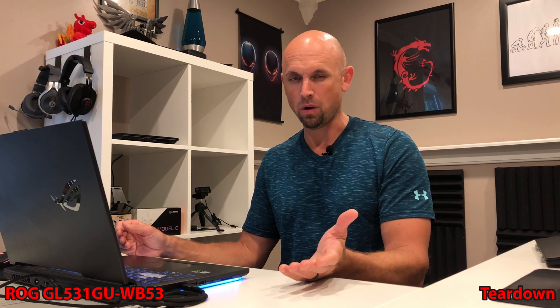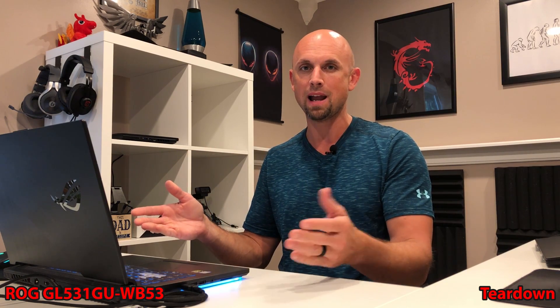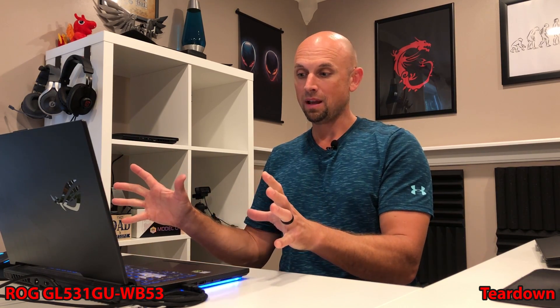To honor that individual through this long conversation, I said the next time I get a laptop that has nothing but thermal paste all over it, I will leave it be and run the heck out of this machine and see if we can get it to blow up. That's exactly what we did here today. I'm not recommending you do that — I would suggest cleaning off that old thermal paste with isopropyl alcohol, putting on a new thermal paste application, or if you're really savvy, thermal pads. I ran this machine 16 hours on load and then gamed on it for 90 minutes. Seems to be working okay so far. I can't honestly look you in the eye and say go for it, green light, but nothing bad has happened either.